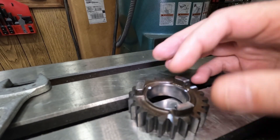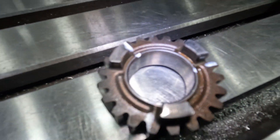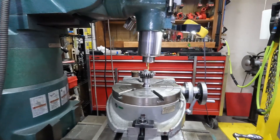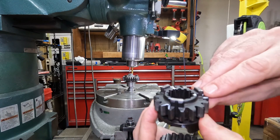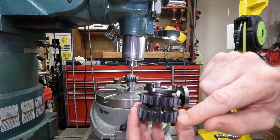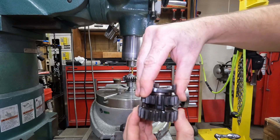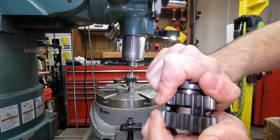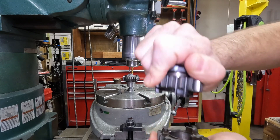This surface is the pull side. Everything on the transmission gear has a pull and a coast side. This is the surface that's transmitting the power, and as you can see, it's worn out. This is a prime example of one that would slam out of gear. You'd have another one here — this one's equally worn on that surface where it's trying to transmit power. Those two worn surfaces come together and instead of forming a contact surface on the same axis as the rotation, since they're worn, they like to bounce out. They just bounce off of each other and there's nothing to hold the torque. On the coast side, which you don't transmit power through, they're still nice and strong — that joint's not going to give up.